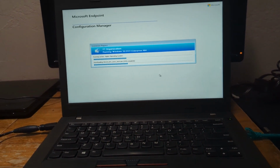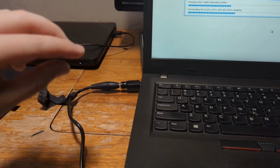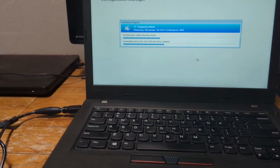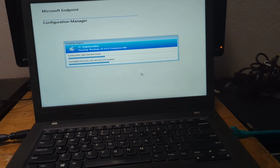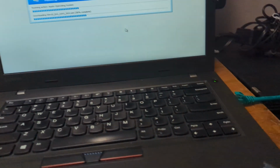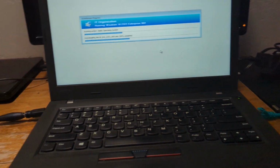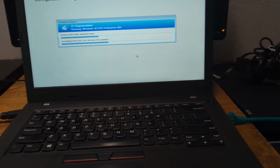But then I'm like, you know what? I should try the old charger again. But before I did, I actually got some compressed air and blew out that port and tried the charger I ordered again. It still didn't power up, and that's when I grabbed my old charger, because at least my old charger showed lights. So I was curious and plugged it back in. It showed the lights, and I'm like, okay, that's a good sign. That maybe means my other charger could be faulty. And sure enough, it powers up.